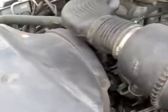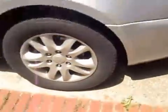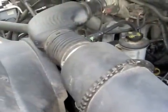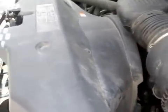If you're experiencing an overheating problem at low speeds or at stoplights mostly, then I would look at the electric cooling fans. On this truck there's no electric cooling fan, but on my wife's car there are two electric cooling fan motors right behind the radiator — one for the radiator and another electric fan for the air conditioner. Some cars have them in front, so open your hood and see where these fans are. Those fans have to be cycling on and off, especially at idle and low speeds. I would definitely check those fans and rule them off my list.